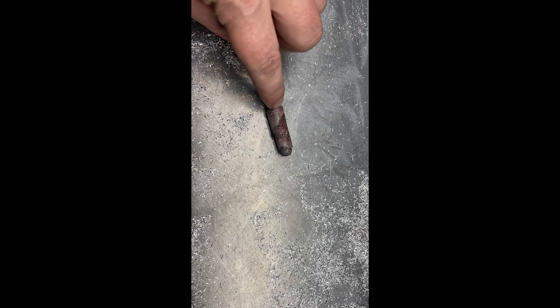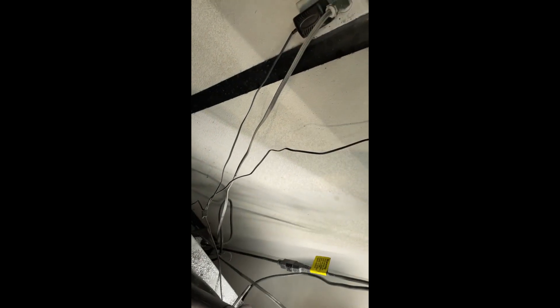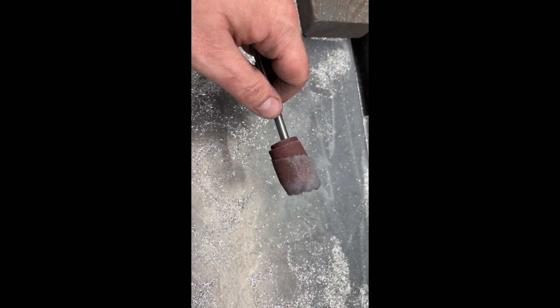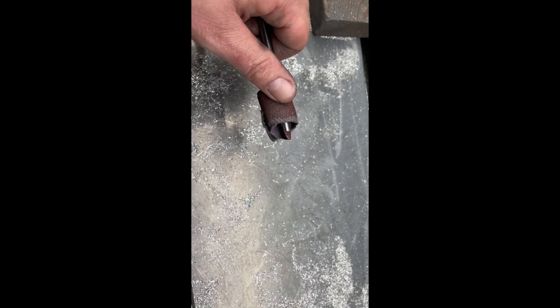After the cartridge roll, I'll use a flapper wheel. The cartridge rolls always have glue at the bottom that holds them together, and sometimes that glue rubs off leaving a dark smudge in the port. To fix that, I use a flapper wheel — there's a groove in the top and I put 60 grit emery cloth in it. I'll do the whole port with it. If you use the flapper wheel, you won't leave a smudge because there's no glue. That's how the port really gets finished out.